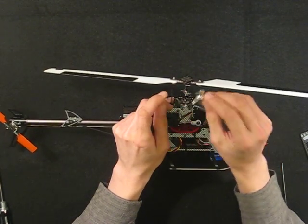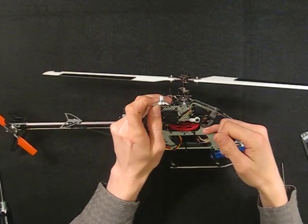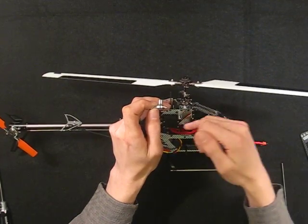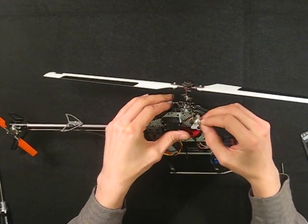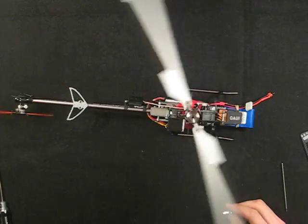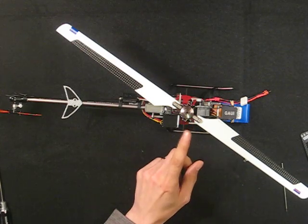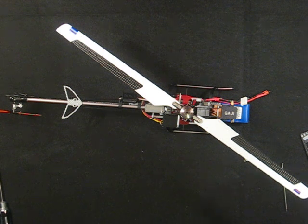The reason that's important is that once you get all your servos at 90, you drop your swash leveler on the bird while you're sitting on one of the three servos — it doesn't matter which one. If you move back to the reference position, you'll see all your servos chatter and move away from where you stuck them. If you try to set your swash plate level there, you're going to be all out of whack when you're done later. So on step G: get your servos as close to 90 as you can, then as you're moving around the swash plate on each servo, leave it on one of your servos when you drop your swash leveler on to level your swash with your links. Once you do that, everything is going to work out correctly at mid-stick in real life when you're out of setup. There's not a ton of documentation in the manual about exactly when you're supposed to level the swash plate — it's on one of the servos, not on the reference position at step G.